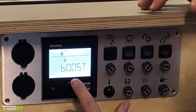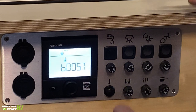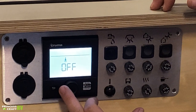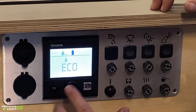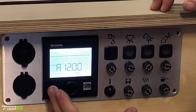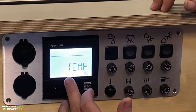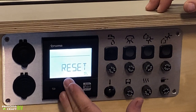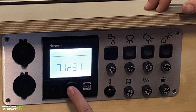For the water heater, select it, get it flashing, push it again, and you can choose between eco, hot, and boost. Boost mode gives you additional hot water runtime; eco mode is an energy conservation mode and won't get as hot. Once you select a mode, it will confirm it's on and using propane gas. There's also a timer icon to set it to start automatically at a chosen time, and a wrench settings menu where you can adjust cabin temperature offset, Celsius or Fahrenheit, display brightness, clock formatting, language, and reset. To turn the whole unit off, long-press the button and let it shut off.